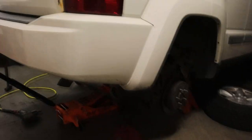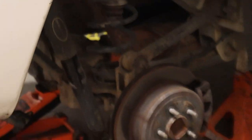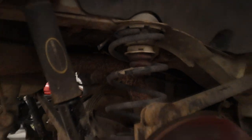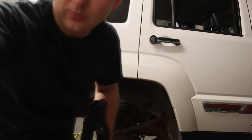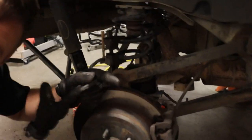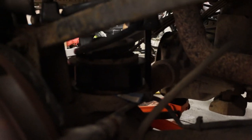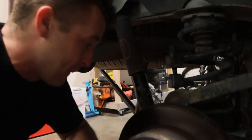Alright, we're back, dudes — we're up. What's up dudes, we're back. We got the Jeep all jacked up — I had to go to work, it's the next day. We got the Jeep all lifted up. The rear sway bar and the rear shock is undone. I'm using the jack to support the weight and the spring is sitting in there, so I'm going to throw some spring compressors on it, take it out, and then pop in the new part. Progress — we got the rear passenger side spring and the spacer back in there. That black piece right here is your spacer. Using your Harbor Freight spring compressors, goes on there — bada bing, bada boom.